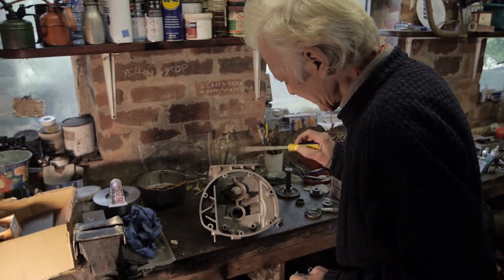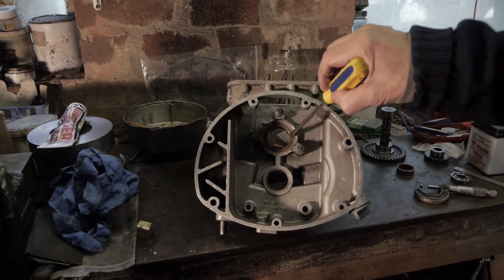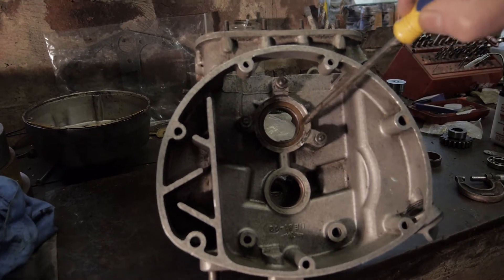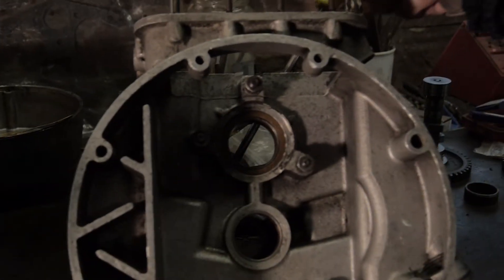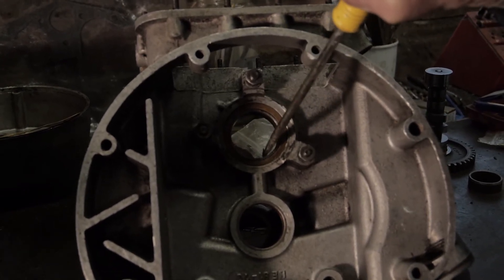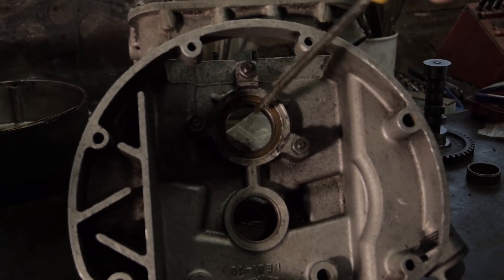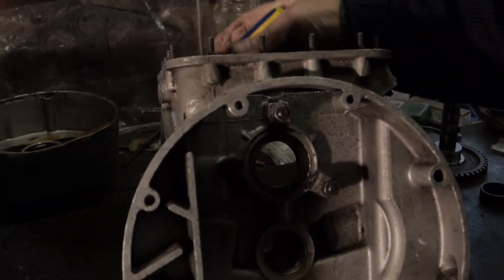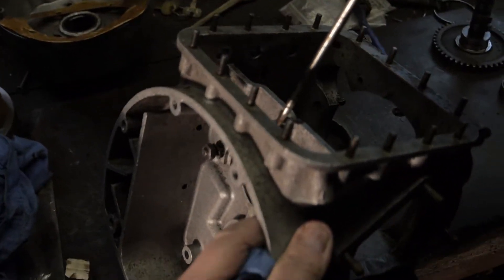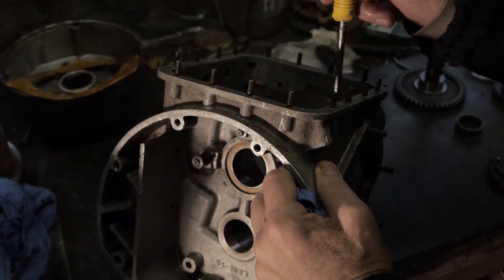This is the rear main bearing here. It consists of a bearing housing — this bronze thing here — which acts as a thrust face for both the crankshaft thrust washer and a thrust washer on the other side. The main bearing, however, is inserted into this bearing housing.